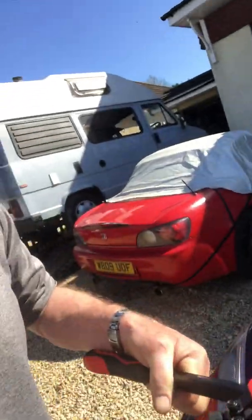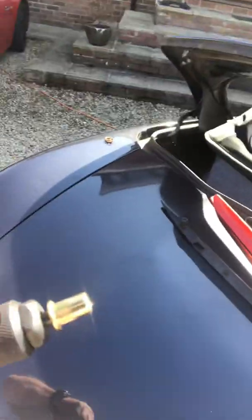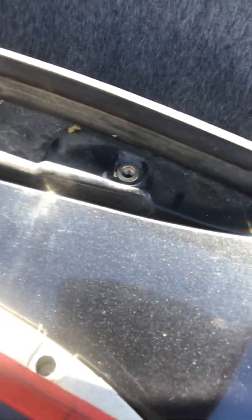Then you go over to the hole and you put it in the hole and then squeeze the handles together. I'm holding the phone so I can't really show you, but you put this in the hole, squeeze the handles together a few times, and this will concertina on the inside. Can you see it there? It'll concertina down on the blind side, so it'll hold that in there. I've done one which I prepared earlier. Can you just see it? Am I doing it right? There, and it's sitting, it's solid.